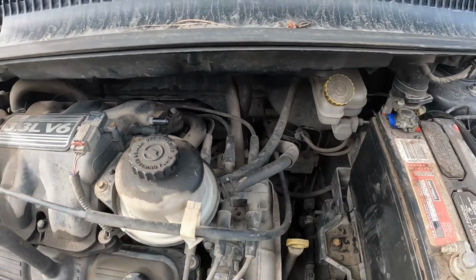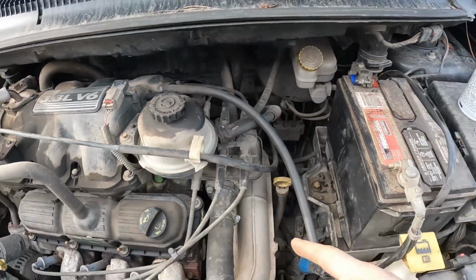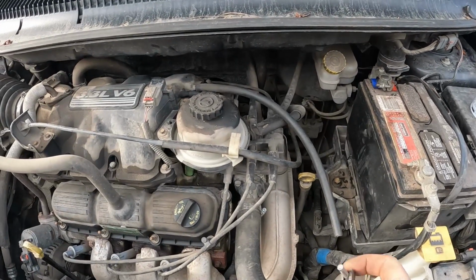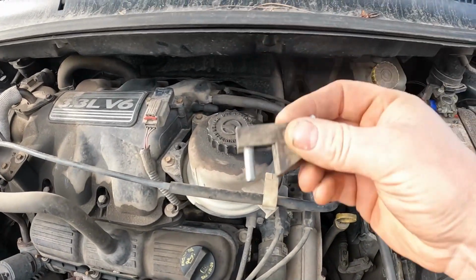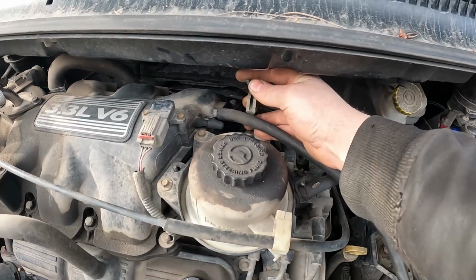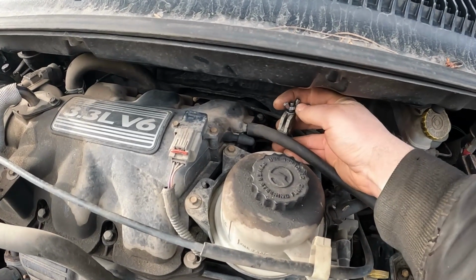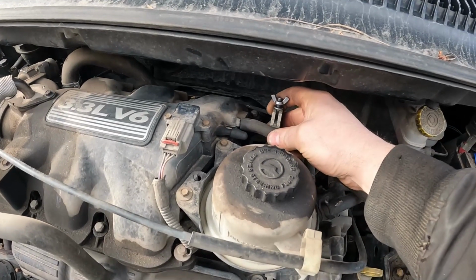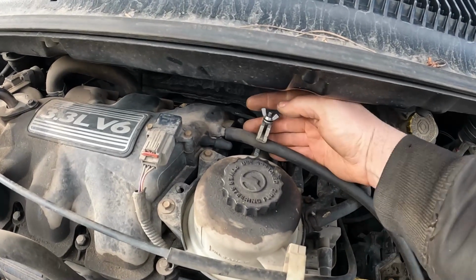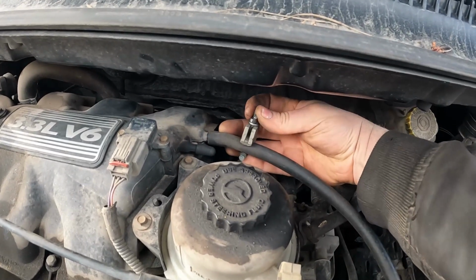First we'll pull this off, hook up our hose. Now, it would have been better if I had a much longer hose, but I didn't really feel like cutting up a brand new line, so this is what I got. Then, ta-da! Our brake line hose pincher, or any kind of small pinch-off tool. Particularly, you'd want something like this that has a wing nut, not the plier style, because you want to be able to adjust this. So what we do, crank this all the way down. So we plug this off.